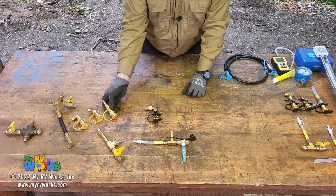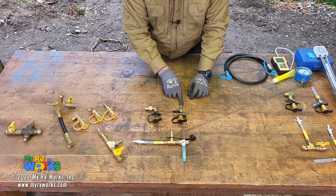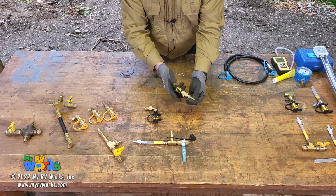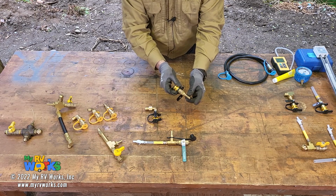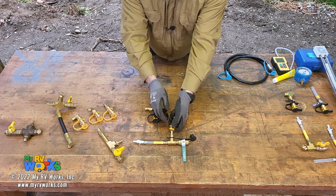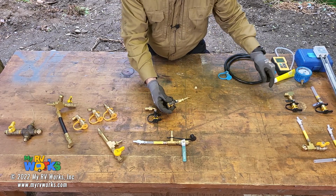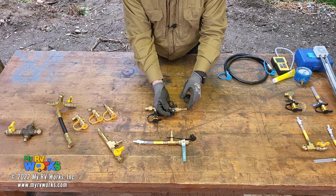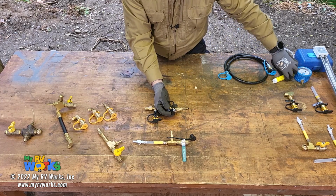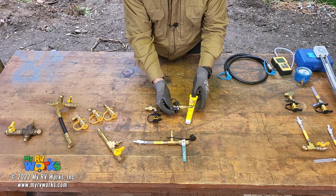And I'm going to demonstrate that here in just a minute. I made another jig here that basically screws into a gas valve with 1/8 inch thread. So you would screw that on, and then just like before, you could quick disconnect it or quick connect it to do your testing. If you're going to go to National Pipe Thread, then you would need a lubricant. You would need a thread sealant to go on the threads.